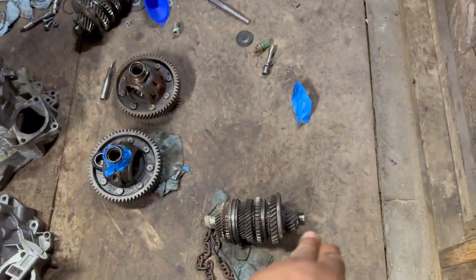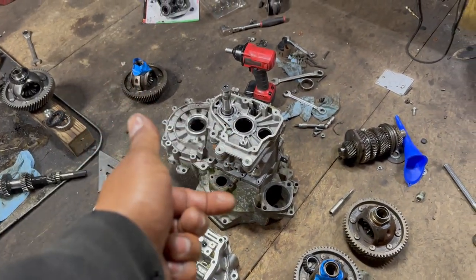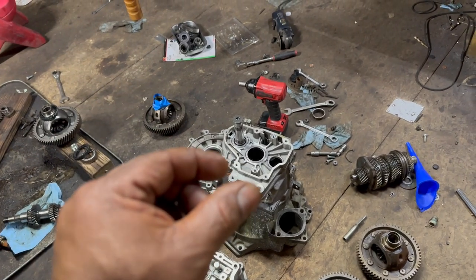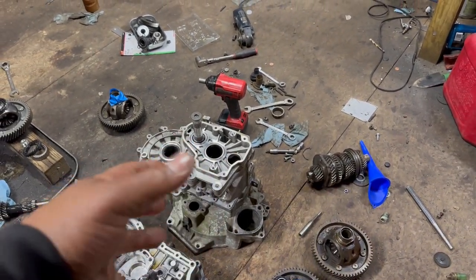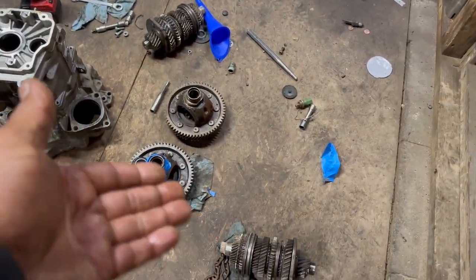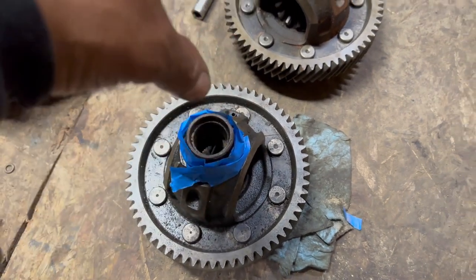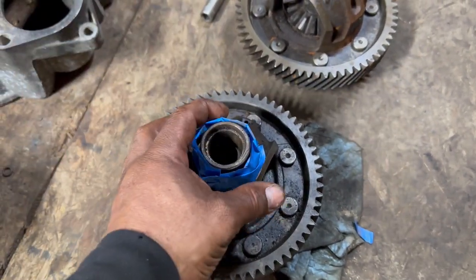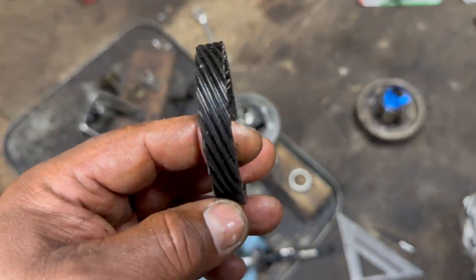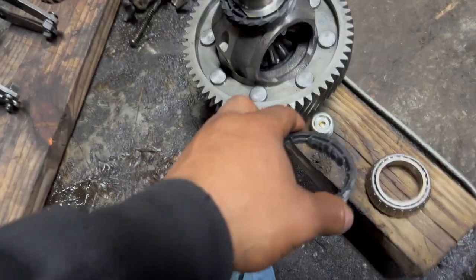So I destroyed one bearing because I thought that thing was sticking out. It was because of the bearing, but no, it wasn't the bearing. The bearing was fine. Remember, I bored the shaft down, put this bearing in there, and lifted the shaft, the whole pinion thing. And that being said, next step, I pull one of these bearings out of this differential, so I can get the gear for the speedometer, because we need this. The new one doesn't come with the speedometer.